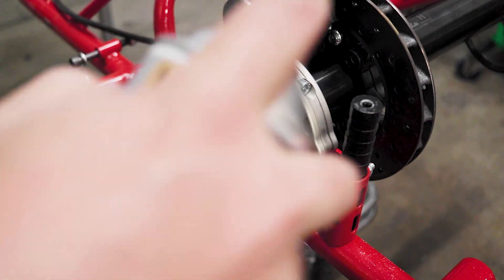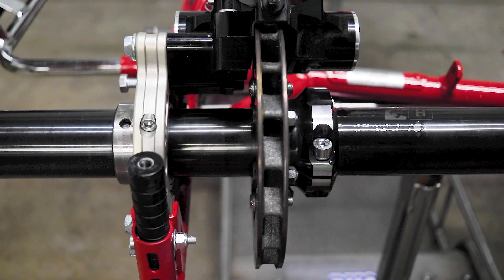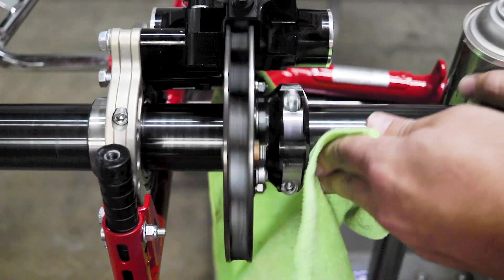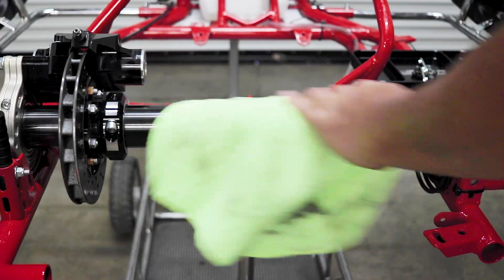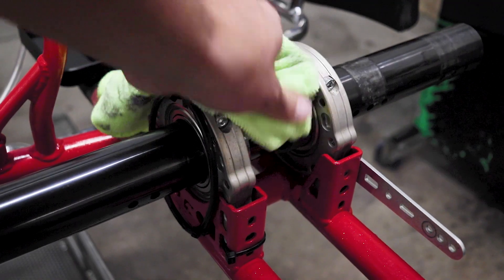The next part is very important — cleaning the axle. You want to make sure you clean the axle really well: get all the grease, dirt, and debris off. If you don't and you slide the axle out, you're gonna be gouging the axle and damaging the bearings. What I like to use is MOC parts wash. This stuff does an amazing job — it doesn't damage the paint but it takes off the grease, and it's got a lot of pressure so it blows all the dirt off. They don't pay me to say this; I've just been using it for years in the shop daily. It's just a really good product.